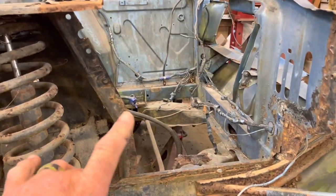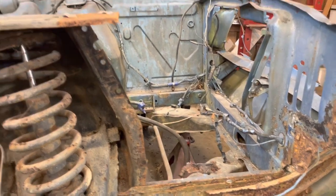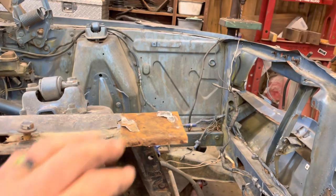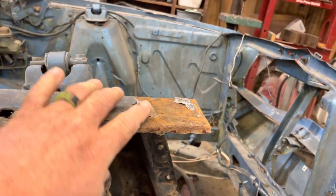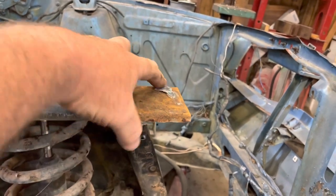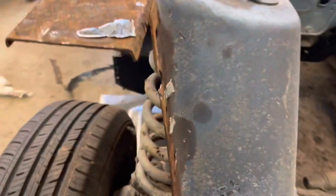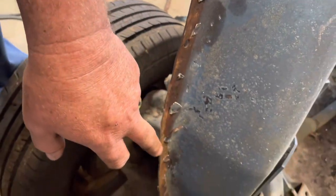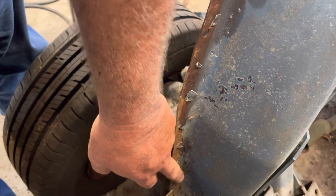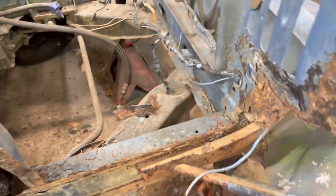All right, so I got out all of the extra stuff that belonged to the old panel that was in there. And the air chisel, you know, it's kind of rough, but what I'm going to do now is take the grinder and clean up all of this stuff that it left. There will be pieces in here that I'm going to have to grind off. But I'll get all this smoothed up so we can start fitting our new panel. Now, I uncovered a little something.